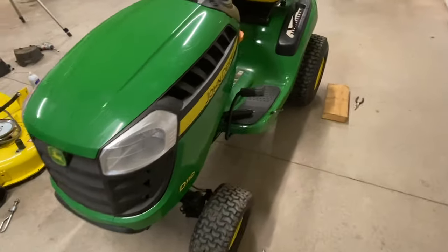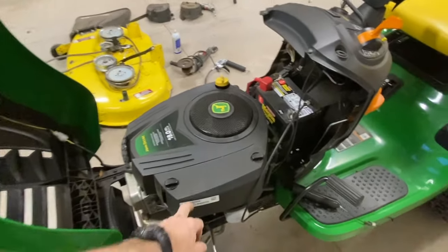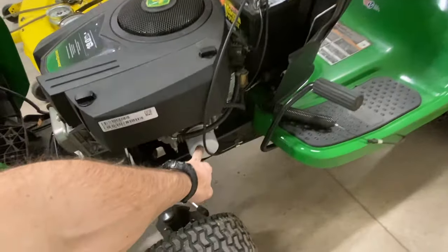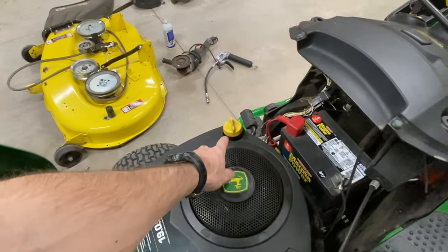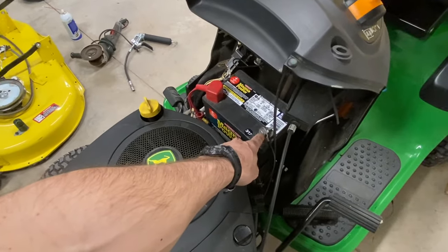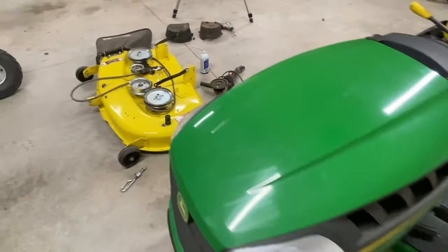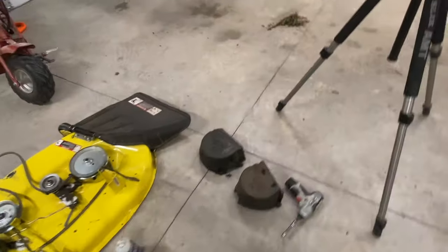And that's all the grease fittings. Before you start mowing, I'd also get in here and check the air filter — I'll put a whole kit in the description with the air filter, an oil filter, and even a spark plug. Check your oil before you start mowing, and maybe check your terminals on your battery. You might also want to take your blades off the deck, clean them up, and sharpen them.